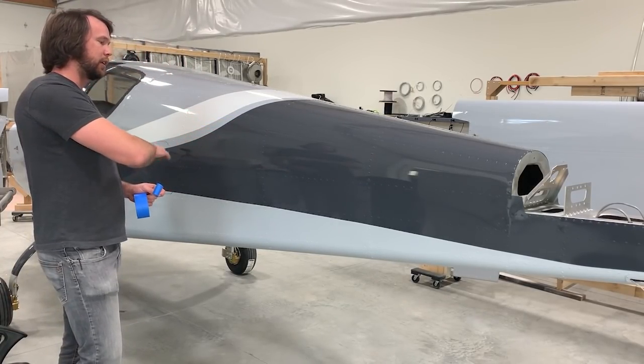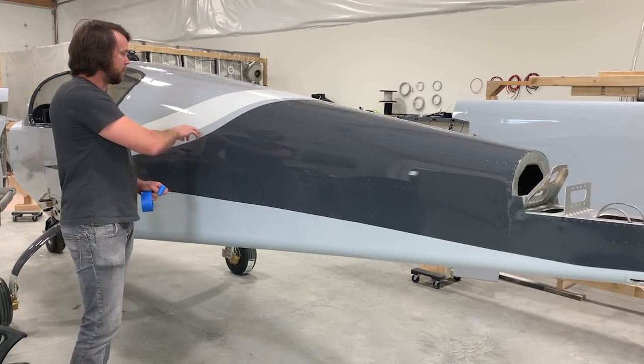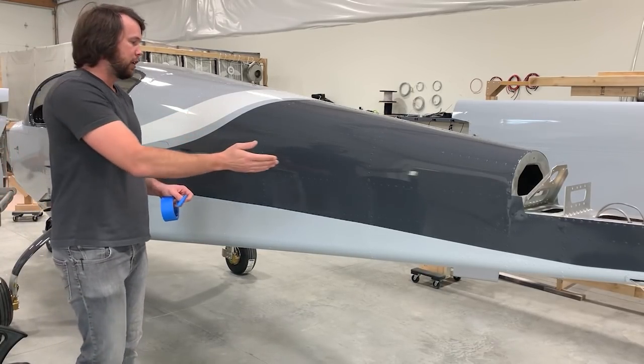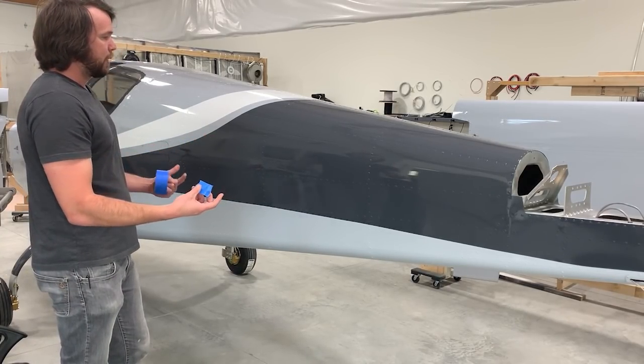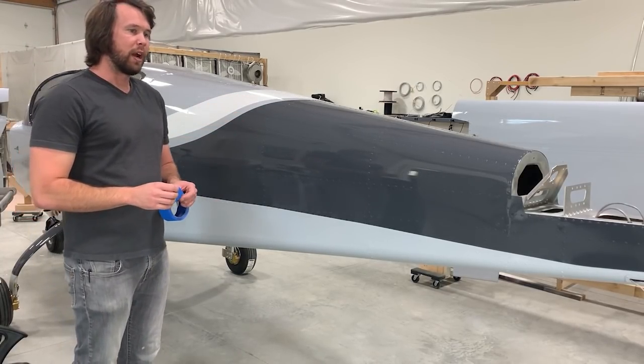Your knifeless tape will follow along the bottom edge, and you want to put the strips close enough together so that you can maintain a good follow of the curve. The tighter your curve is, you'll want slightly closer and slightly narrower pieces of tape. Where the curve is more gentle, you can use slightly longer pieces, but still don't leave any room for potential waves in your taping.